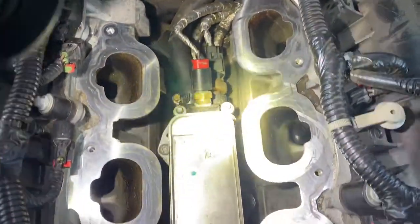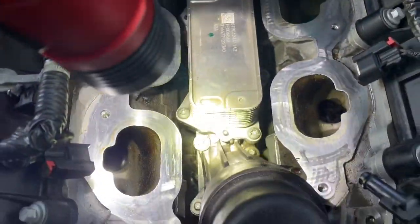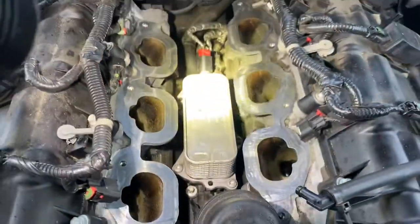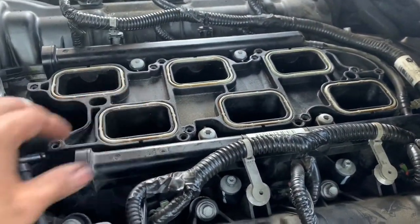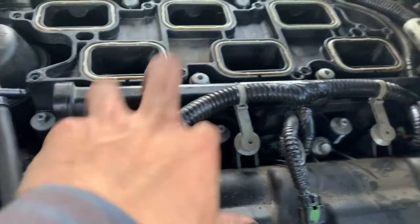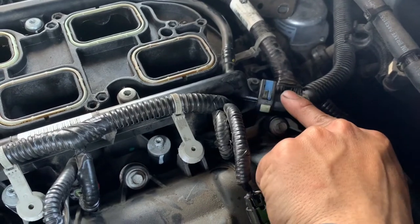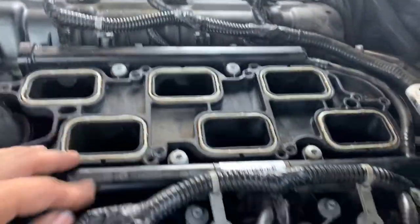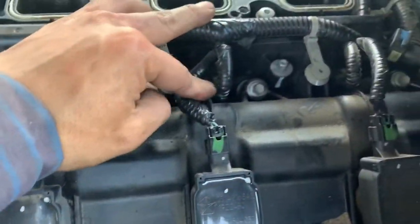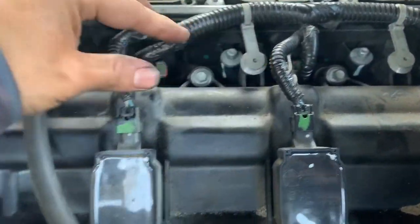The housing is back on. Make sure everything is tight, check the connectors again, the hose, and tighten down all the torque bolts. Clean out the head surface right here and put back your bottom manifold. Tighten down all your 8mm bolts. For the fuel line, make sure you press it in all the way, make sure you hear the click, then push the blue tab back to lock. Reconnect all your injectors too - make sure it clicks and press the red tab down to lock it.